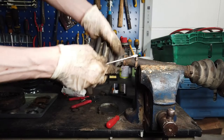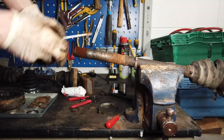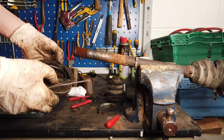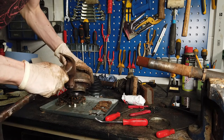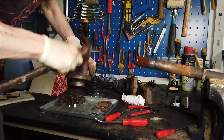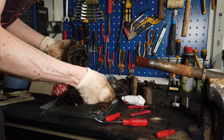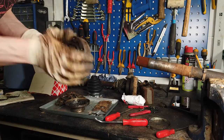That clip's off and we have movement. So we've got the drive shaft free now. We'll take this CV joint and try to clean as much of the old grease out of it as we can, then repack it with the new stuff. I just noticed I forgot to get this last piece of the CV boot off the CV joint - this metal piece. I'm just tapping it off. Okay, that was probably just dried, burnt hot grease holding that on. So we've got the joint all ready to be cleaned now.